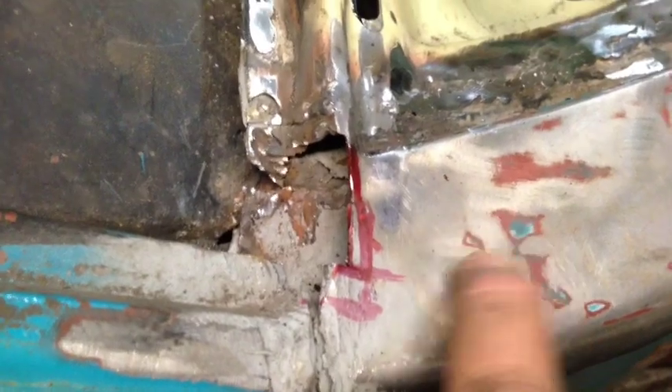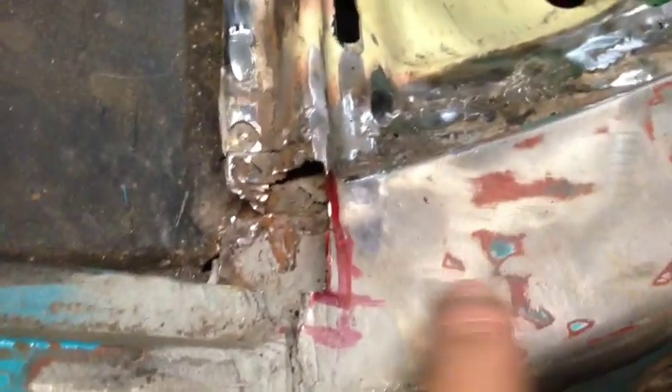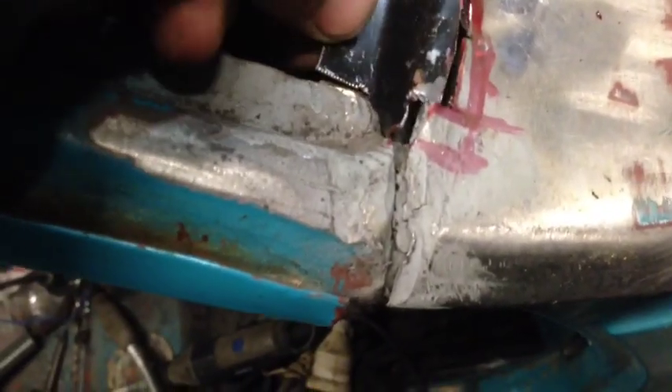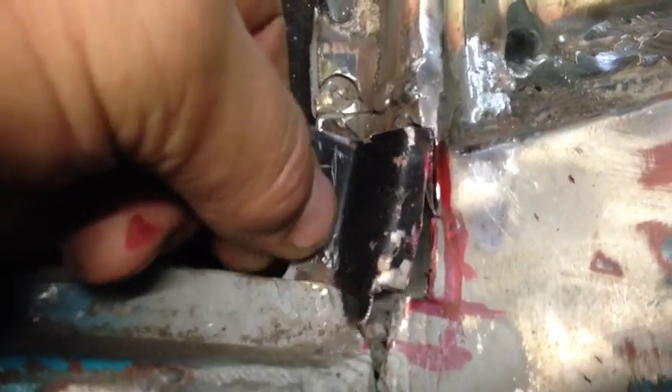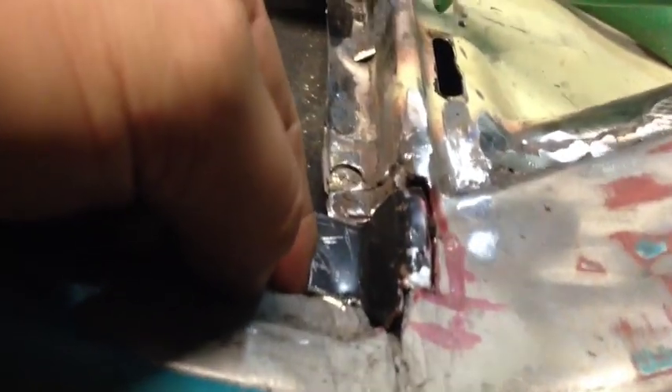I had a big rust hole underneath here which I treated and filled the whole rust hole up with weld, so that's taken care of. I've welded this bit back down and now I've got to fix this part of the corner of the window. I've been cutting a little piece to fit and it nearly goes in there, I just got to keep trimming it a bit more, then put a little bit of a bend in it so it goes with the curve. It's nearly there.